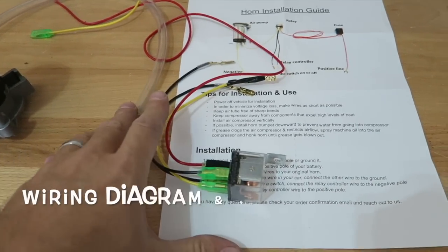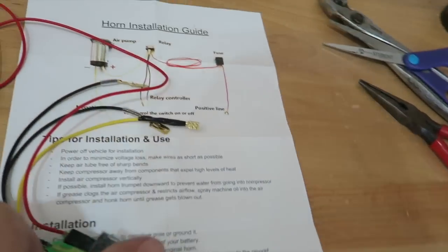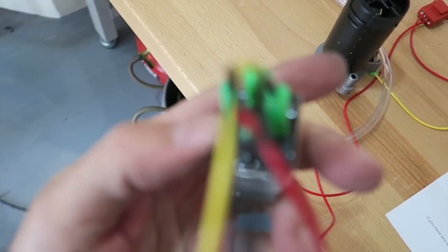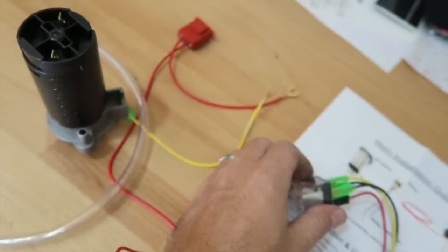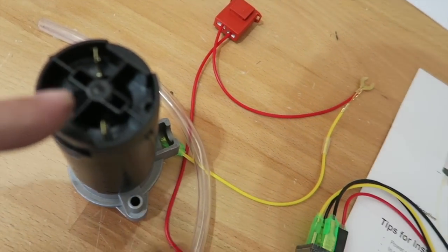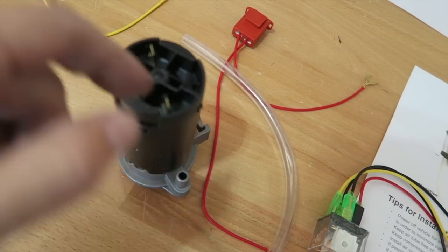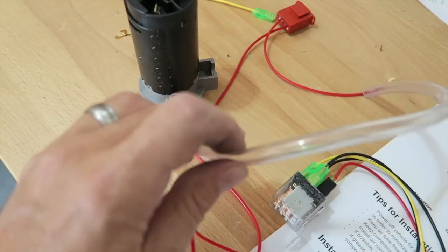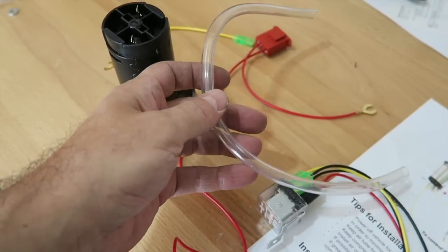Now I have to mount the air pump and connect the wiring. I'm going to connect part of the relay up to the air pump before I mount it. On your relay you have a yellow wire — these are all numbered. Number 87 on your relay is the yellow wire; that connects to the positive terminal on the air pump. Then there's another yellow wire for ground — connect that on the other terminal and ground it to a bolt down there. The hose goes on the outlet and connects up to the trumpet part.